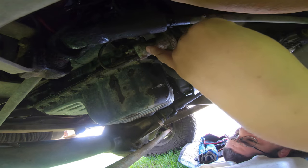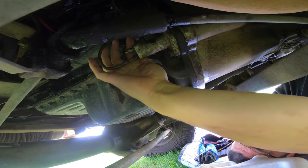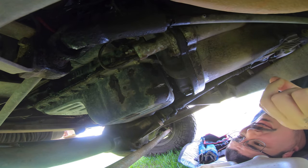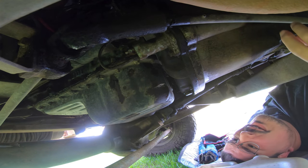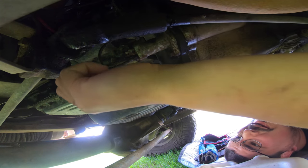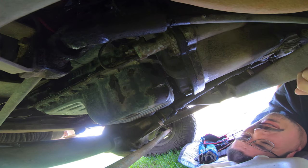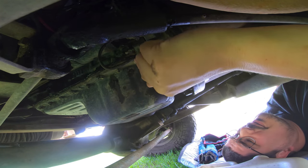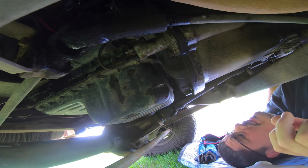All right, this is our clutch slave cylinder. There's a nice little hard line, the little U-bend, that goes up to the body, and from there it goes to a flexible line so that there's not a hard linkage between the engine and the chassis. Otherwise that will vibrate to pieces. While I'm here, both the grease nipples for the winch shaft are exposed too, so they may get some grease. I did actually use that the other day. Anyway, first thing we need to do is get this guy off, and we've got our drain pan underneath.